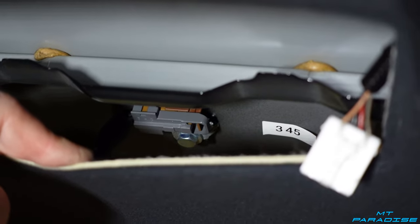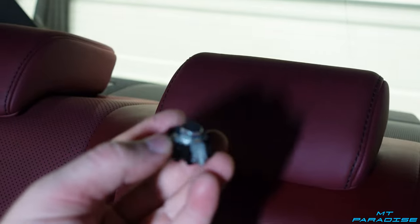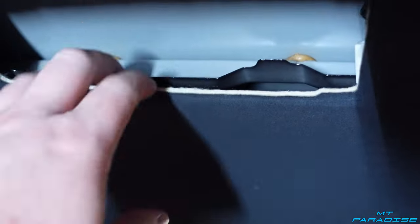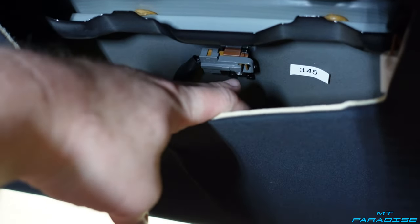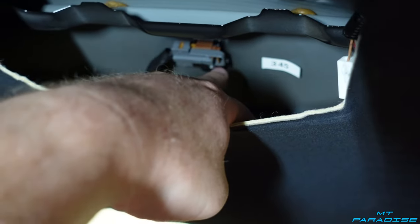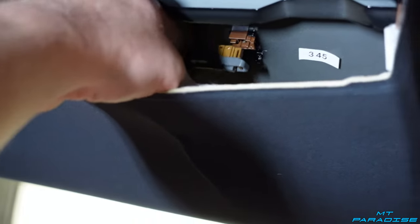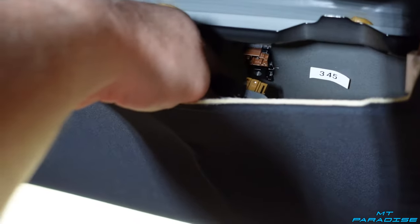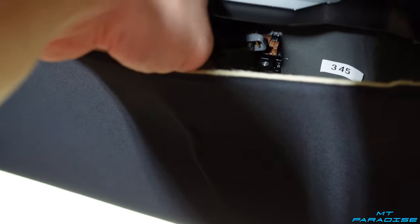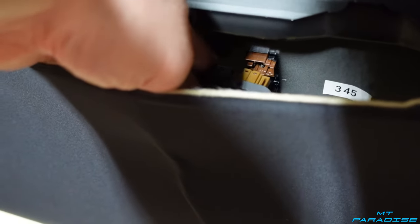Go ahead and unscrew that and we should be able to just pop off the shark fin. So I took off the part that has the bolt in it — it's a little plastic piece, the bolt comes out of it, and these just pop right off. Looking up there now, that is gone. Now we just have to unplug it: there's a little brown tab right here, push that tab in, and you can unplug the shark fin. It pops straight down — push the little brown tab inside the gray piece to the left and the whole thing just pops straight out.